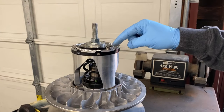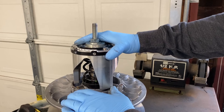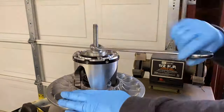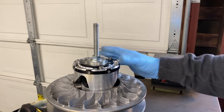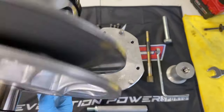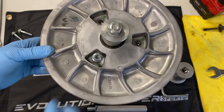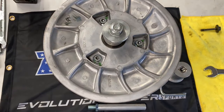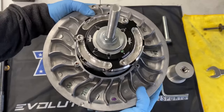If you're using the Shift-Tec, set the degrees to negative 45 — it makes installation so much easier. Otherwise, spinning clockwise, tighten the 7/8s until the helix passes the rollers; be careful not to damage the rollers. Once it is snug and everything looks to be clearing okay, take it back over to the stand where we'll be reinstalling the 13mm on the back side. With the two arrows aligning on the front and back, place the clutch into the stand, reinstall the 13mm and torque to 45 foot-pounds. Once the three bolts are torqued, flip it over, remove the tool, and move on to the primary clutch.